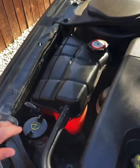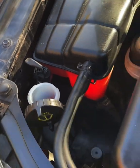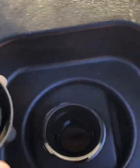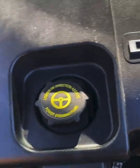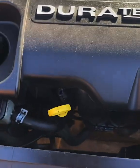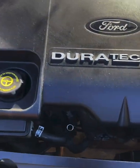So the bonnet's open now. The washer fluid is more or less full but I do just top it up more or less to the brim — don't go right to the brim in winter in case it freezes. The coolant level is on the maximum line, so that's okay this week. The power steering oil — I actually flushed it out and changed it before I started doing these videos. There's oil in there at the level I set it. I changed it because it goes green regularly in this car for some reason. The brake fluid is on the maximum mark. The oil dipstick shows the oil is on the maximum mark as well.